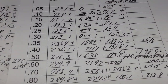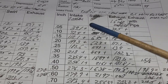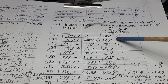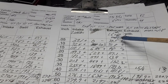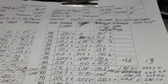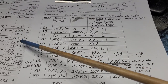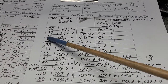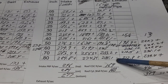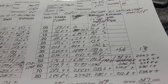Take a quick look at the exhaust. Take a look at the huge difference in low lift flow. I think it was Gary that said he'd take that valve without the back cut for a win, because he doesn't want this very high low lift flow — you wind up getting a lot of reversion that way. DV loves low lift flow — I'm going to have to have a conversation with him again about that. We had a touch of noise at 0.15 — we started going up, got up, up, up — then we got minuses right in the middle where we don't want minuses. But it did top out a little better on all of these, just a small amount. So I'm going to say that port doesn't like that tulip shape much.